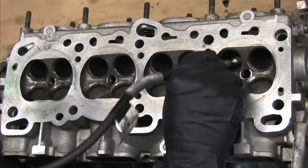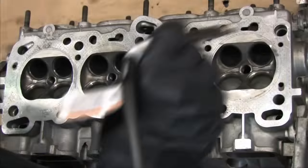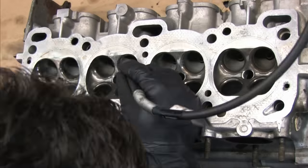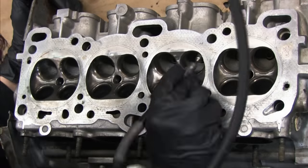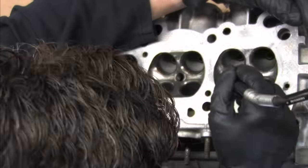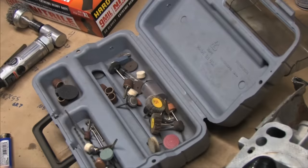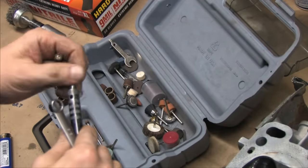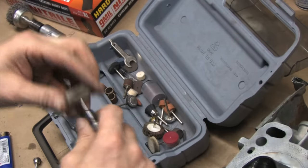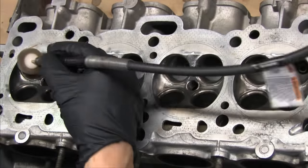Excessive carbon buildup or sharp protrusions in the combustion chamber can heat soak or cause hot spots. These hot spots can affect your fuel mixture by prematurely igniting it if its volatility threshold is exceeded under compression. Some fuels are more resistant to this than others, but if this happens prior to your spark plugs firing, or before your engine crosses top dead center at the top of the compression stroke, it will quickly melt parts and destroy your rotating assembly.